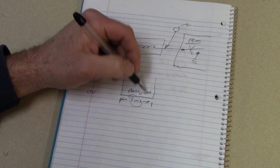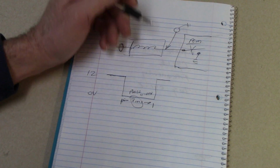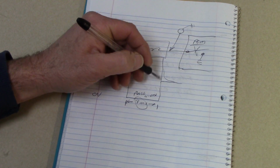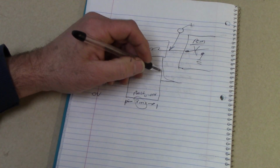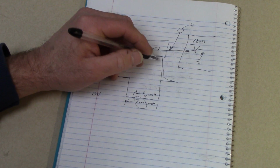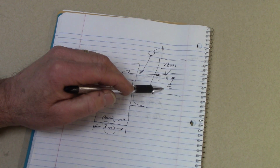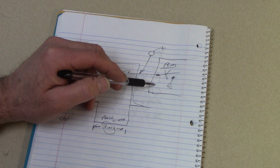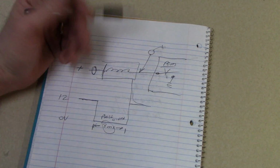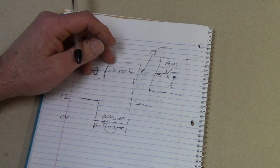When the injector turns off, it returns to battery voltage, but since it is a coil of wire, it spikes. We get a high voltage spike. That voltage on that spike can go as high as 120 volts. Typically the PCM will clip the spike off because inside the PCM, in parallel with the transistor, they use a Zener diode, which they call a clamping diode, which at 60 volts many times will clip that spike off to prevent that high voltage from going back into the PCM.